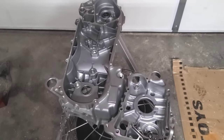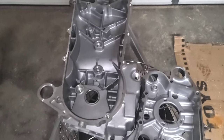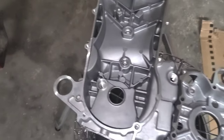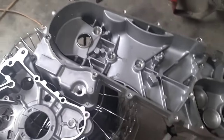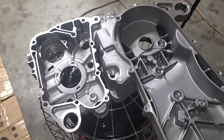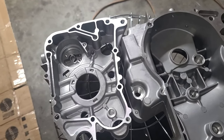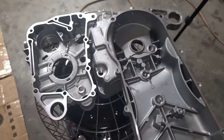We find that some people will use torches, but I feel that this kerosene heater right here is gonna get a lot better heat displacement overall. As you're doing this, the thermal expansion — where one object's cool and one object's hot — it really does work, and it's just the science behind it. So try it out guys. That way you're not spending all afternoon fighting something. It works really easy and there's no damage to your bearings in the end, so it's definitely worth it.